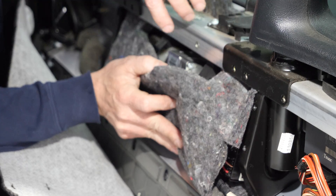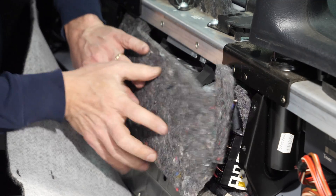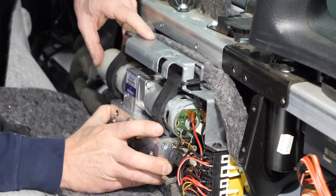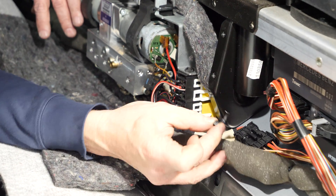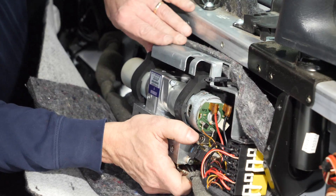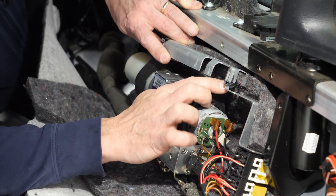Here's the pump in the middle between the seats, with sound dampening material around it — we removed two staples. The top of the pump's mounting frame is secured with two Torx T30 bolts from above. We pull the pump out, and we also cut two zip ties: one holding a bunch of hoses on one side and another on the other side. Now we have room to move this pump up and down. We make the job a little bit easier by pulling the rubber grommet of the motor out of the hook above.